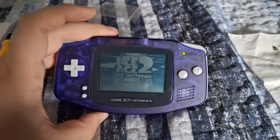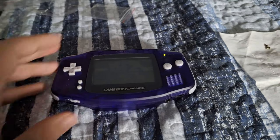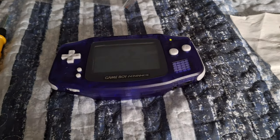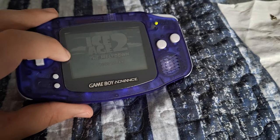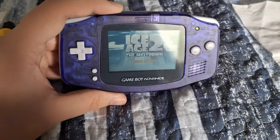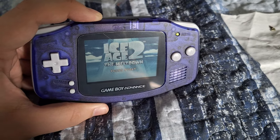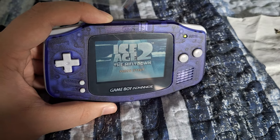It's not backlit as you can tell when you're not right up close to the screen, but this is a perfect addition to my collection. The Game Boy Advance shell is super easy to replace — just make sure you have the tri-wing screwdriver and a small Phillips head, since most kits don't include the Phillips. Get a kit that includes everything: replacement screen, all the buttons, to make it look great. I absolutely love this purple — comment below what you think. Hope you enjoyed the video, take care!